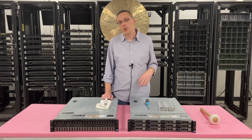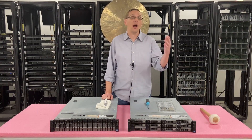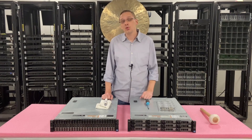If you don't have one, you can order a V1 for a really cheap price, put it in — you only need one of them — update the BIOS, update the firmware. If you're not sure how to do that, we're actually going to cover that later in the series with step-by-step instructions, and then your V2s will work.